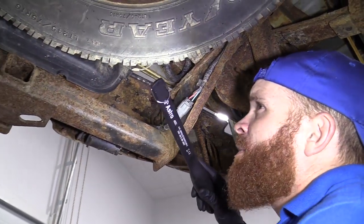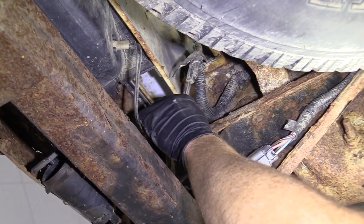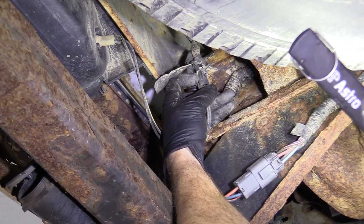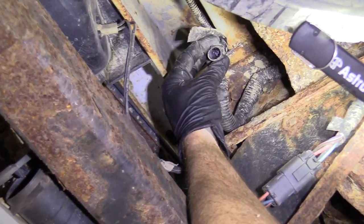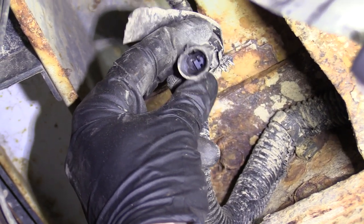We're going to grab the torch and start blasting this out of here. Our new bumper assembly is going to come with new plate lights, so we're just going to disconnect the whole harness. Right here, grab this little tab, give it a little wiggle and a little tug. Take a peek up in there — make sure you don't see any corrosion, blue, green, brown, red, moisture. Everything looks good there.